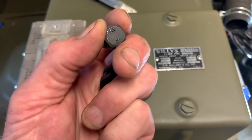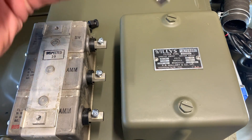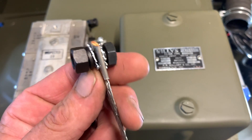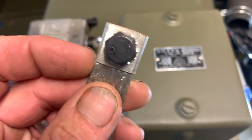I used the 33070 Ron Fitzpatrick Jeep Parts OD green that I've been using to paint the Jeep. I've got four reproduction EC marked bolts — they're 5/16 by 18 by 3/4 inch — and I've also got the bond strap from my Joe's Motor Pool bond strap kit, plus some modern star washers that I'm going to be using for the install.